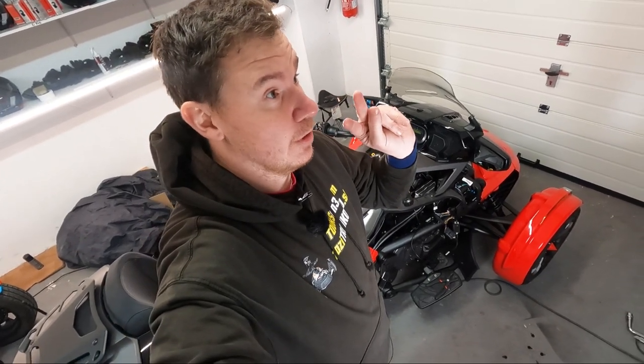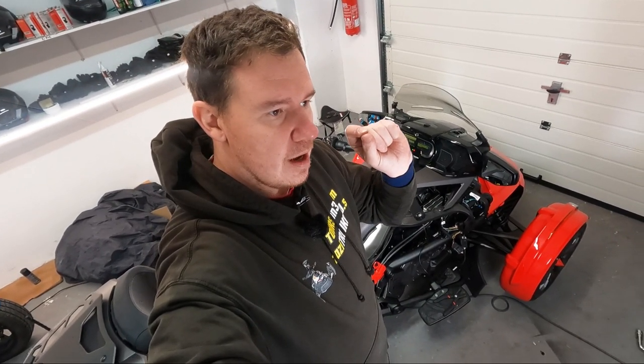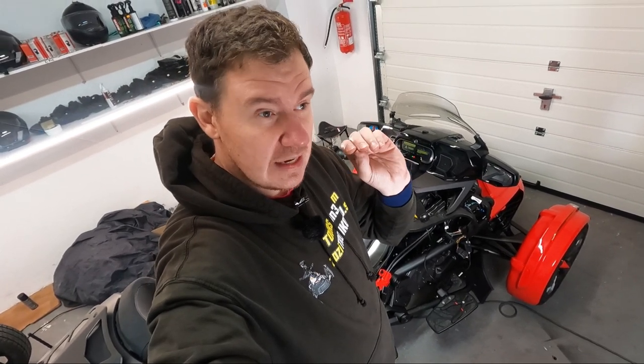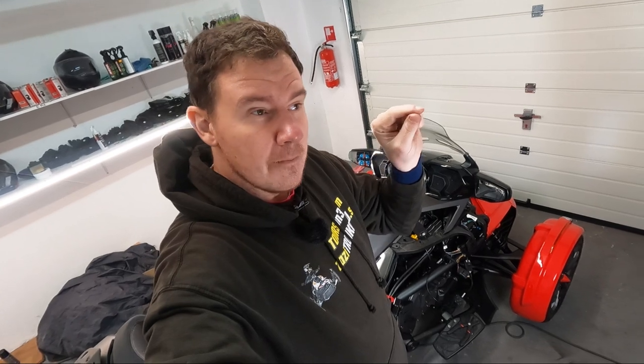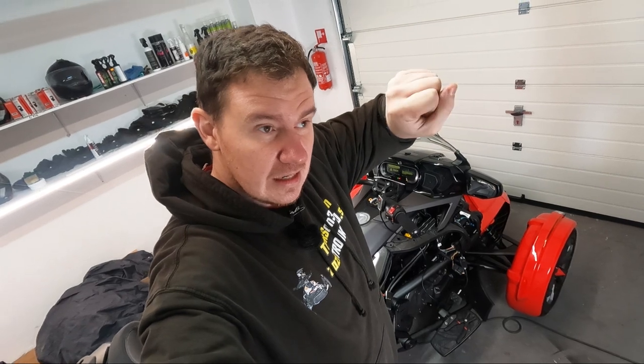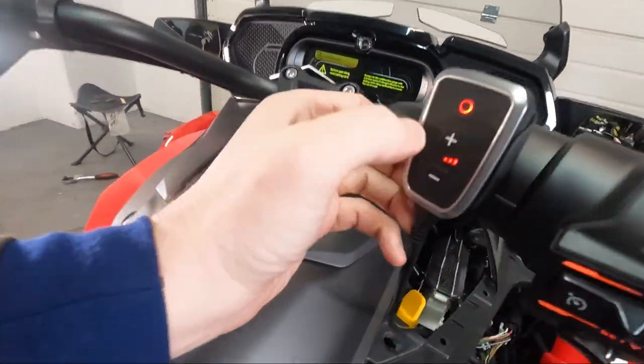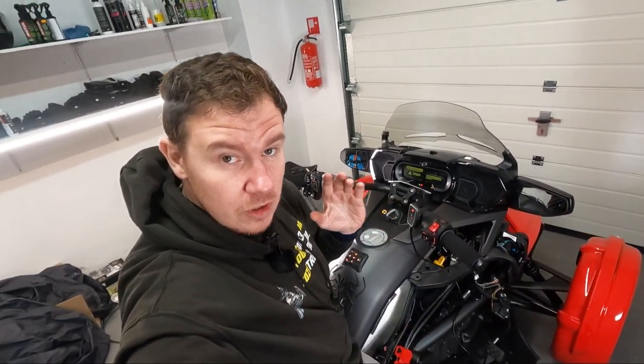Please understand: the most common two issues in 99.8% of cases are — one: people do not pair their bike with the pedal box. You simply don't do it, and that's the main issue. As you can see, it doesn't always have to be your mistake — just the unit on some bikes doesn't go all the way on the first attempt, and people think they're done. Two: many people don't confirm the pairing by holding the main button — you need to do that. Three: the most common issue is that when you hit the throttle, your throttle is not set up to go all the way up to the maximum. Those are the most common issues.